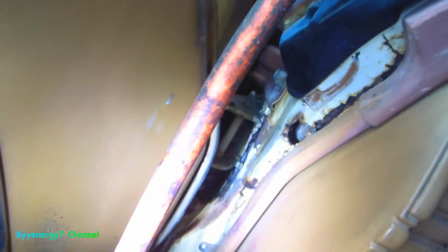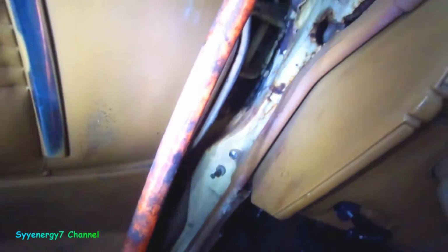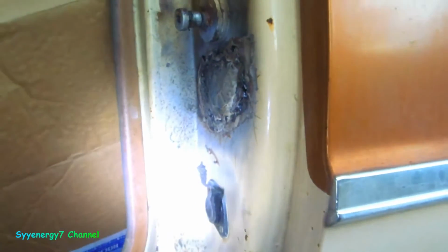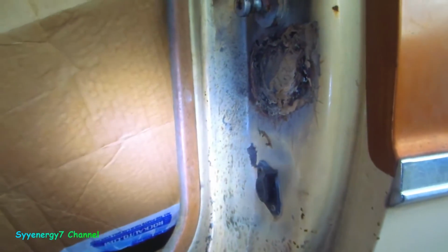There's not much rust on this car. As you can see down here, that isn't rust. That's just some dirt. That's one of the reasons I'm going to use Rust-Oleum in here. With the rust killing primer, I'm going to chemically clean all that, scuff it up, clean it several times, go over it with the rust killing primer, and give it a coat of Rust-Oleum. The Rust-Oleum holds up very long as long as it's not in the sun. The UV kills it. If it's down in places you can't see, it's just like an industrial enamel paint. It holds up under the hood, and it's okay inside the trunk. It's UV that kills it. So anyway, I'll put some panel adhesive on there right now, and once I finish this, I'll go to that. That's how I'm doing it, one section at a time.